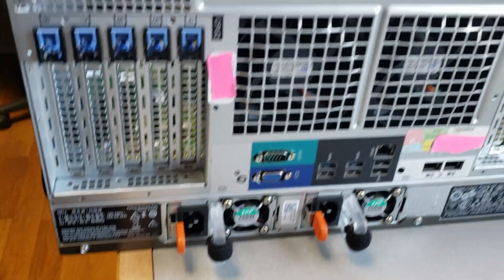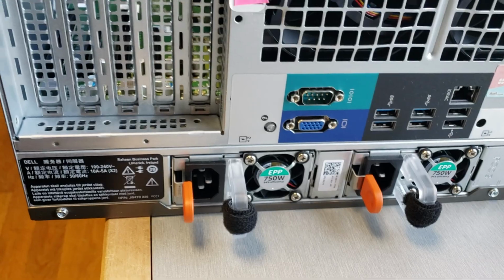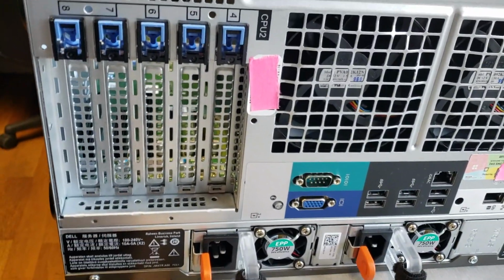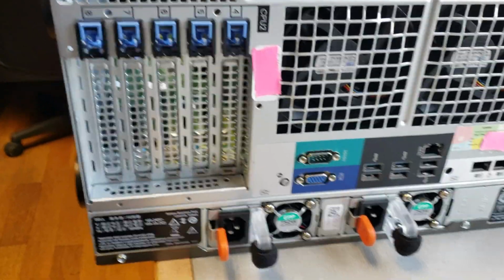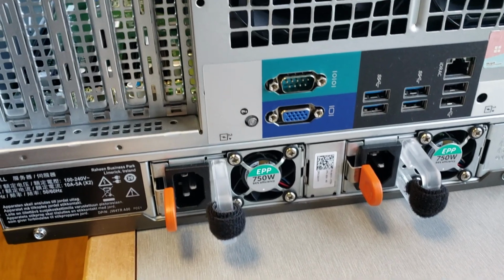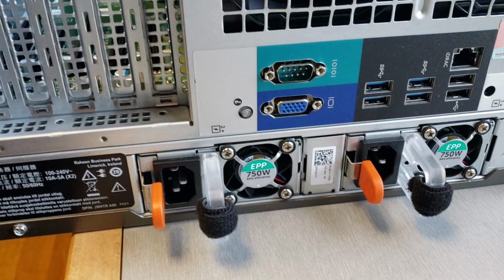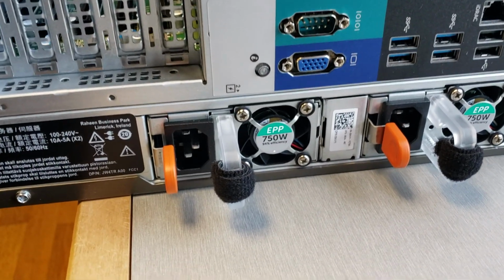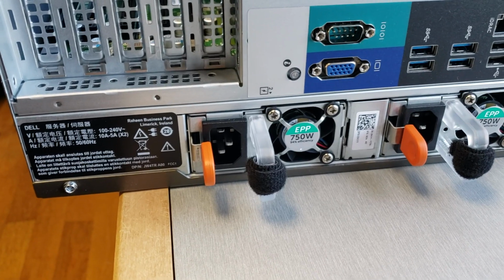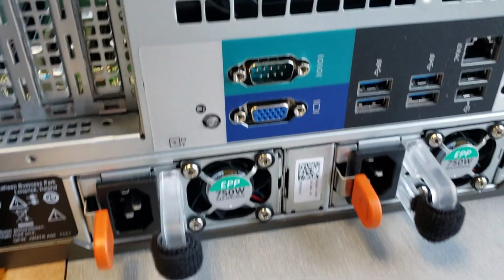the server functioning. Also, I buy 2 UPSs for these servers because I've had a single UPS just die completely and not work, or there's a particular kind of event as far as the electricity in the building that can knock out a UPS, even a new modern UPS. I've already been through it. So now I get 2 UPSs and try to avoid as much as I can in terms of downtime.